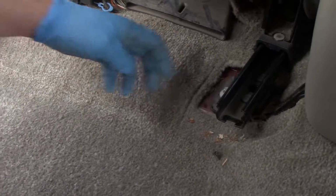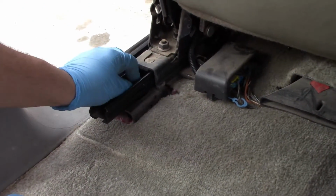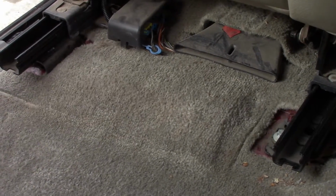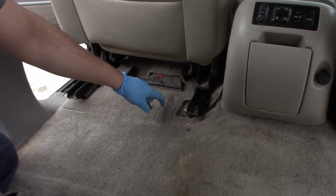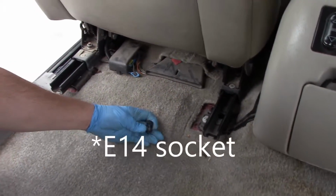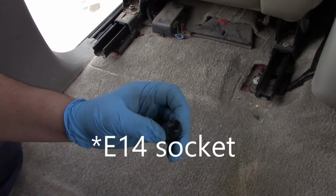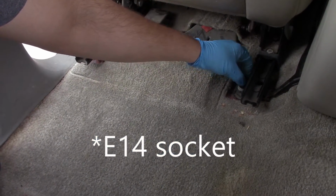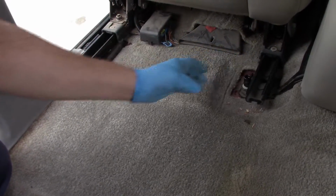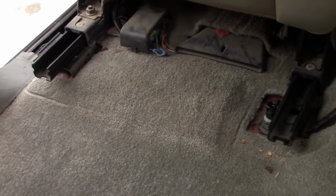Again, this is a different size. Let me go figure out which one. On these back bolts, the reverse Torx are a different size, but the compatible size that you can use is a 7/16 12 point. Goes on there, and I'm wiggling that thing. Hardly has any kind of wiggle to it. Again, do as I say, not as I do.